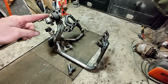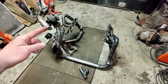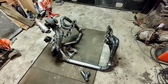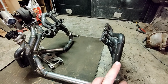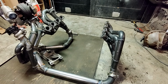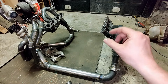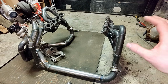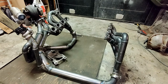As I have already chosen to drive with one turbo, that's gonna be a problem in every layout because if I would like a really responsive, OEM responsive type of setup, I would really like to run two turbos, one here and one there, and then the exhaust manifolds would have a really small volume, and then short pipes with very good directing primaries into a single collector, and then a small turbo with much more responsiveness compared to this one with the large inertia.